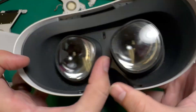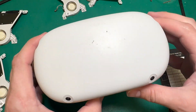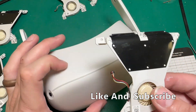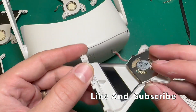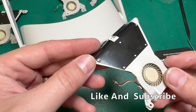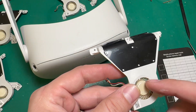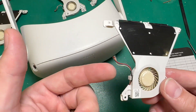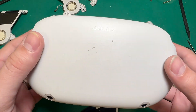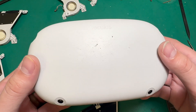And that's all there is to it. Now the fan's working on this — we're not getting that overheating error, and it's ready to go back to its owner. I hope this video helped and you learned something. Remember, if you're having an overheating issue with your headset, or you're getting that internal alert that your headset is overheating and needs to be serviced, it could just be a simple fan issue. It could be as simple as one of the fan blades being broken, or just being dirty on the inside. In a worst case scenario, the motor is broken and that fan needs to be replaced. If you can think of any other videos you'd like me to do — any other repairs, teardowns, or tutorials — please leave it down in the comments below.